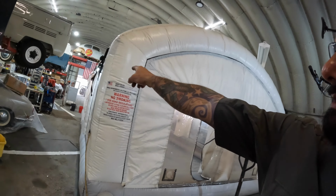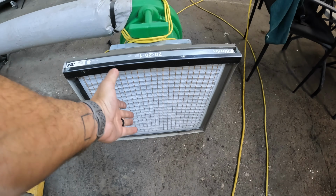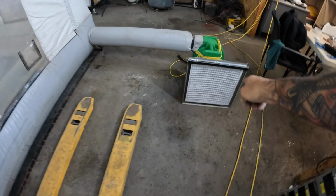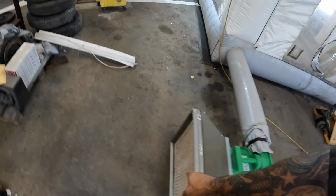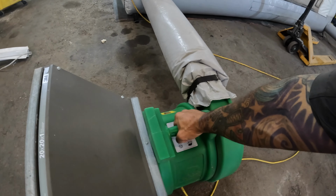So that's why, if you notice, my lighting is on the exterior. You know, we don't have lighting on the inside, because if it sparks while you're shooting, you're going to explode. You're going to die. So my buddy Tom Siesco made me these registers. I just put cheaper ones, he made them for 20x20 AC registers that I could just drop in there. So like when we do a fresh paint job, it gets a set of fresh filters. It'll get to a point where these start getting discolored by whatever color we're spraying. So we'll put new ones in. It's cheap, it's economical, and it's repeatable.